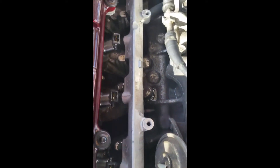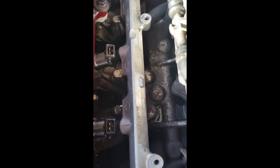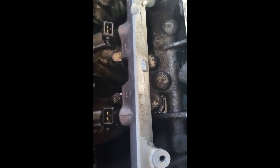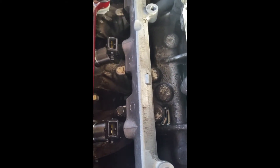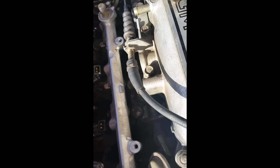Got the fuel rail back on — I took some time to actually clean it, so it's a little cleaner now. These two at the end went in really well, just kind of have to jiggle it a little bit gently. Don't super force it — there's a new ring, so you just gently slide it in and it feels nice and snug, compared to how it was before.